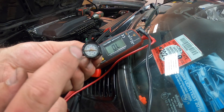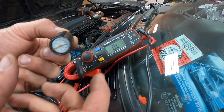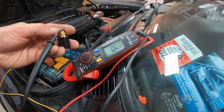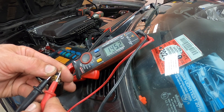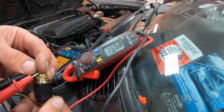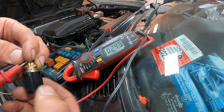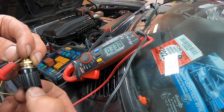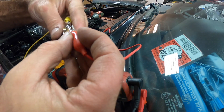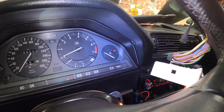This is my potentiometer — it's a 1K ohm potentiometer, meaning these two leads go from zero to 1,000 ohms, which is perfect for the E30 indicator. You can see that it's reading right around 145 ohms on the multimeter. As I'm twisting the potentiometer, it's changing the resistance — it's getting higher. Now it's 0.243, basically 243 ohms, and it's going to continue to go higher. So if we hook this directly up, pretending that this is actually the sensor, you can see how the indicator on the cluster changes.